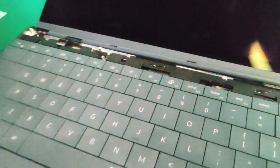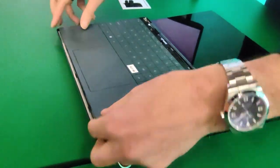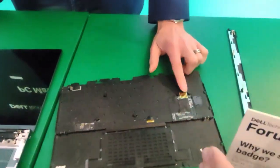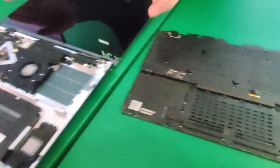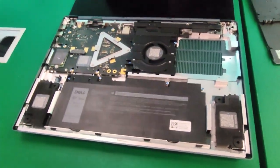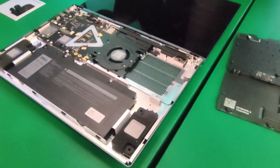Once we take that off, I'll lay it flat. The first thing we're going to do is take off the keyboard - just slide the keyboard up. So that's the keyboard. First thing you'll notice is it has some edge connectors on here - these play a role with some of the components and how they interact with the system. First thing you'll notice is there's no wires. Typically when you open a laptop you'll see wires for the display, wireless antennas, your wireless WAN, 4G, 5G card. There are no wires in here.